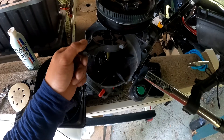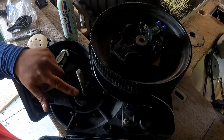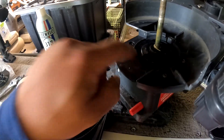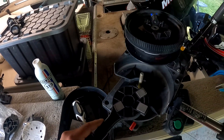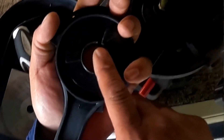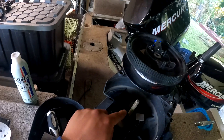We're going to pop this up and put it to the side. Now you will reveal that spring — notice the opening on that spring and notice it's seated on top of this wheel that has a cog-tooth to it. You don't have to take that out, but you can give it a clean if you'd like. This is going to be the new spring. Now we're going to put our brake handle back on. If you flip it over, put your hand on the brake so you don't lose the pads — there's a little notch right there, that's where the spring goes. Flip it back upside down, put it over the hole, and keep an eye on that notch at the back so it sits right on the spring.